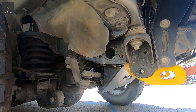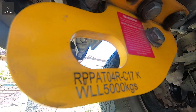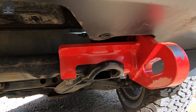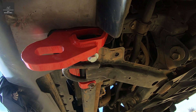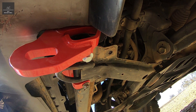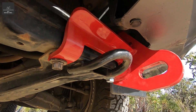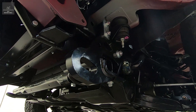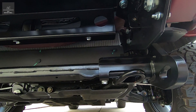It's also important to note that the manufacturer of these points doesn't actually call them recovery points, but rather heavy-duty tow points — something to consider. Compare these to this ARB recovery point, which suits an Isuzu D-MAX, MUX, and even a Holden Colorado. The design is quite different because the vehicle chassis is quite different to that of the Patrol's. It also uses much thicker steel, is rated at 8 tonnes, doesn't have to be used in pairs, and is rated at the full turn angle of the front wheels. The ARB recovery points tend to be more expensive, but I believe the extra cost is worth it, and they are also made here in Australia.